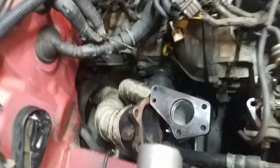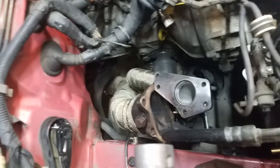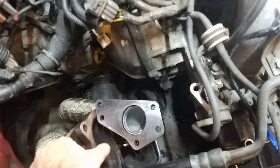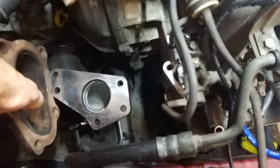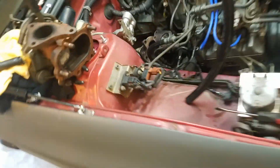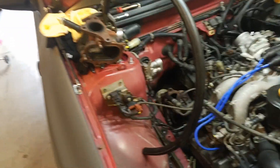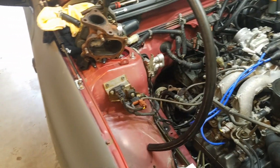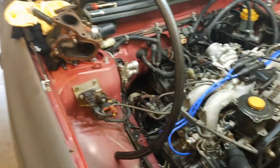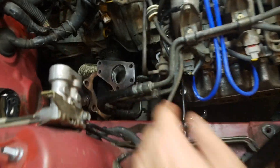So you can see where I am right now. The downpipe has one bolt in it — I put it in just to see where it would line up — and it lines up perfectly when I have the turbo on. The uppipe is already bolted on with a gasket. It's pretty self-explanatory, just two bolts putting the uppipe in. These two bolt holes are not used when the turbo is mounted — you can see there are only three that are used.